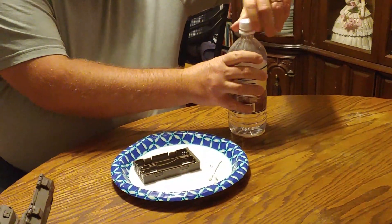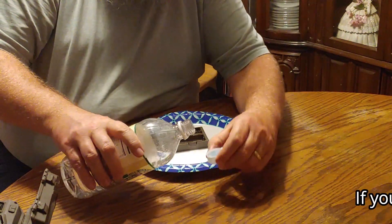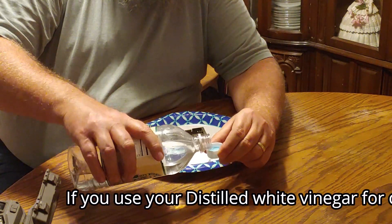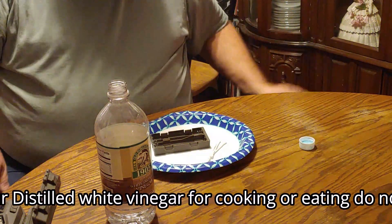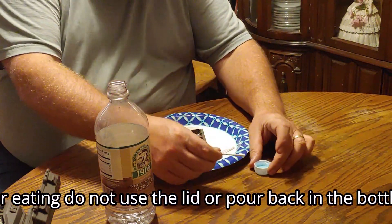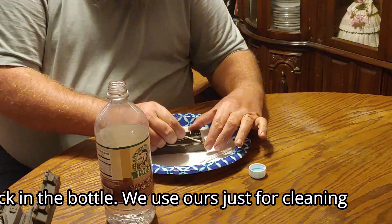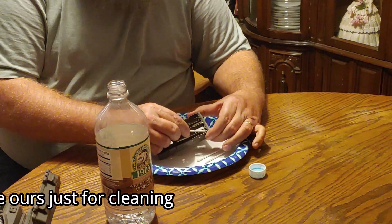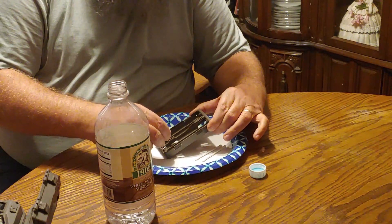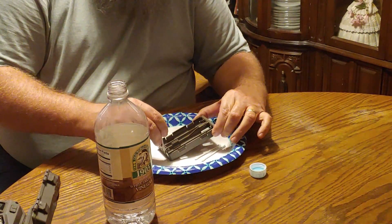And some q-tips. What I did was simple and I fixed it, got it working again. Take a little bit of your vinegar and pour it in your cap because you're not going to use a whole lot. Whatever we don't use, we'll dump in the sink or pour it back in the jar. Take a q-tip, soak it in that vinegar and just start wiping off all your metal pieces. If you've got a blue powder build up or white powder build up, just start wiping all the metal pieces off until you get that build up off of there. Make sure you get inside the spring really well.